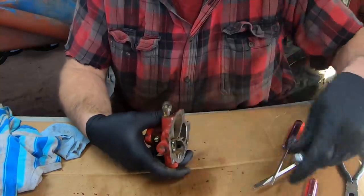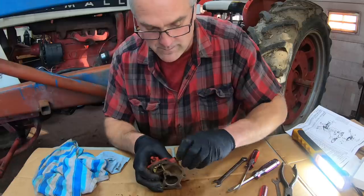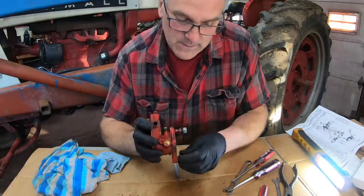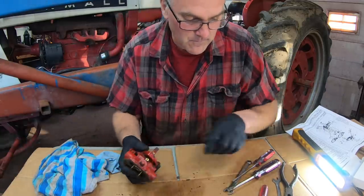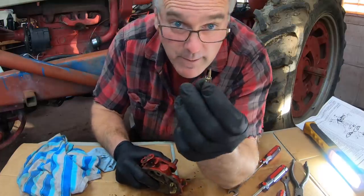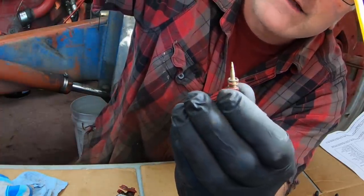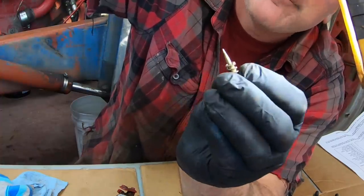We're going to go ahead and take this fuel inlet off. Typically there's a screen in these — that's kind of the final defense of the carburetor from grit coming in, so we'll clean that up real good. These go in the parts bucket — these are where it hooks onto the intake manifold. Pull this idle jet out, that'll get replaced. The points wear on these — I don't know if you can see, but there's a burnished spot about a third of the way down. That's wear on the jet — somebody probably drove it into the seat too tight. That'll get replaced.